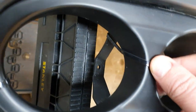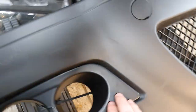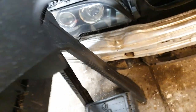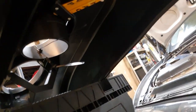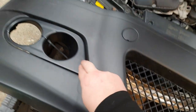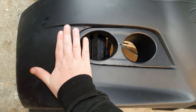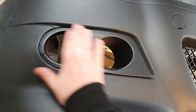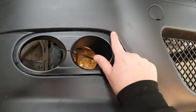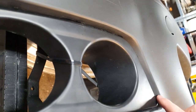We've put a cable tie around here, around this back part of the bumper, and then cable tied this bit to this bracket — which I think is for your fog lamps — to keep that nice and strong. For the moment we've just put a piece of card behind that bracket, and now that is lovely and strong. It's a good base to put our fiberglass on all the way across, then filler, sand it all back. We want it lower than this so we keep that line.